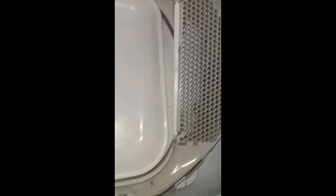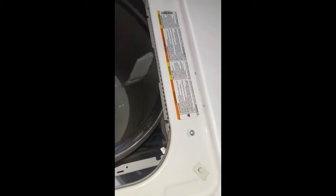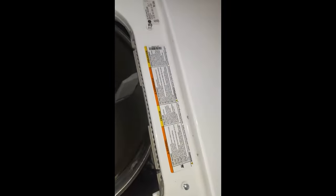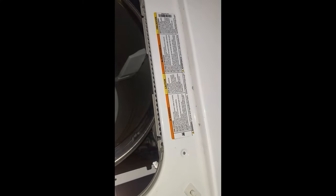This is really kind of important right here. This is the back side, the inside — here's the door opening right here. So I got the whole panel turned around. I was cleaning it out here. What I want to show you is I'm going to turn this thing around. To get this gray panel off and really clean it good, there is a pop button right up here on the side. But also, in order to remove that gray panel and really give this the best cleaning that you can, you got to remove these two screws right up front — they're Phillips. We're going to take those off, flip the panel back around, and then we'll clean it up.